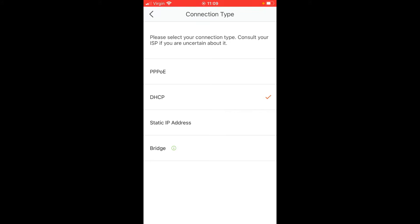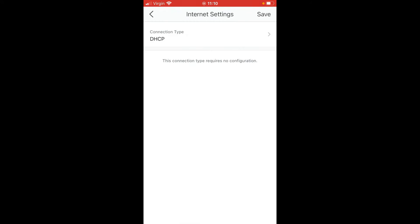Once the Virgin Hub is in modem mode, make sure your Tenda connection type is DHCP. On the back of the Tenda router, you can plug a network switch into the LAN port — the port next to the WAN port with the dash and arrows — to connect additional wired devices. You can also plug devices directly into the LAN port of any Nova node; just make sure it's the LAN port, not the WAN port, and it will receive an IP address from your system.